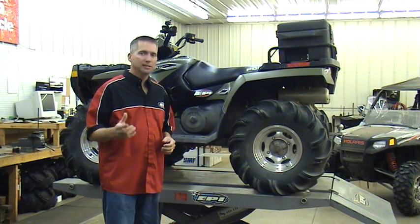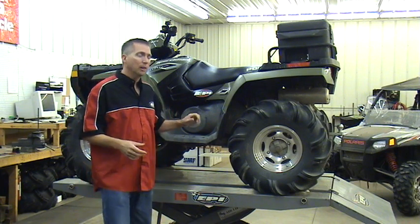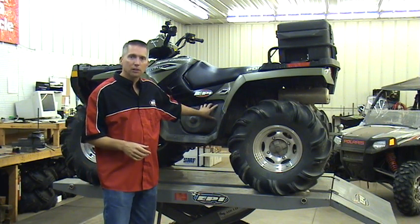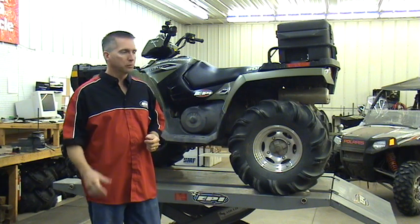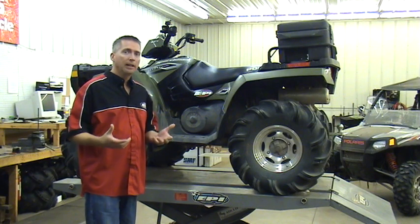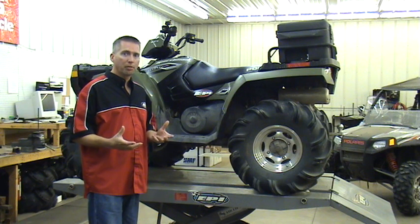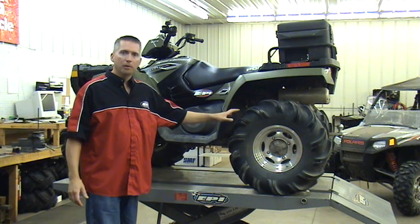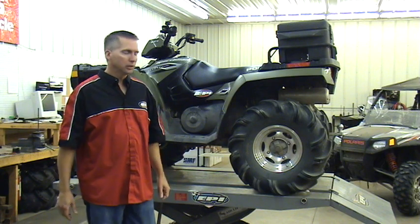The stock clutching is not set up to deal with tires like this. So the end result is you're going to create a lot of belt slip, and that equates into a lot of additional heat under this clutch cover. The belt and our clutches are running way hotter than they're supposed to. How it feels to us as we're riding is it may feel kind of sluggish, especially if you get in some thick, deep mud. It isn't going to turn these tires the way it should — the belt will be slipping too much.